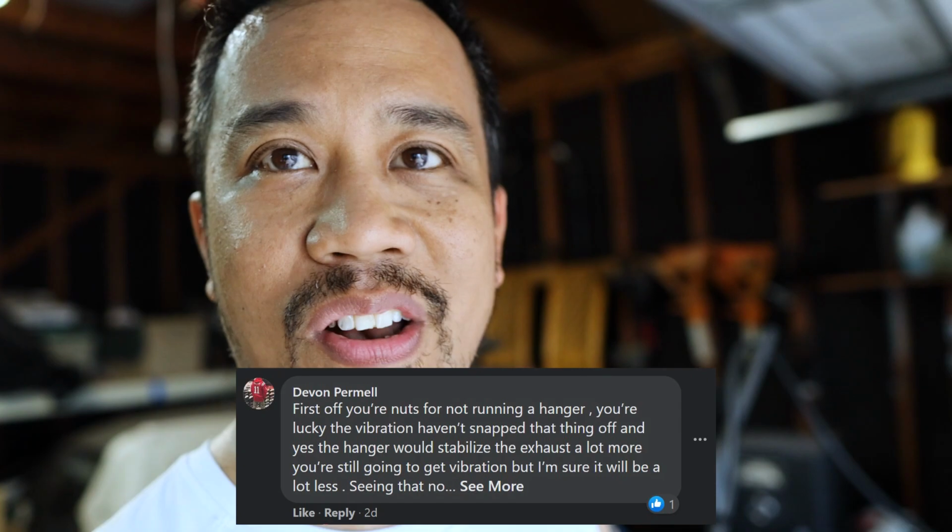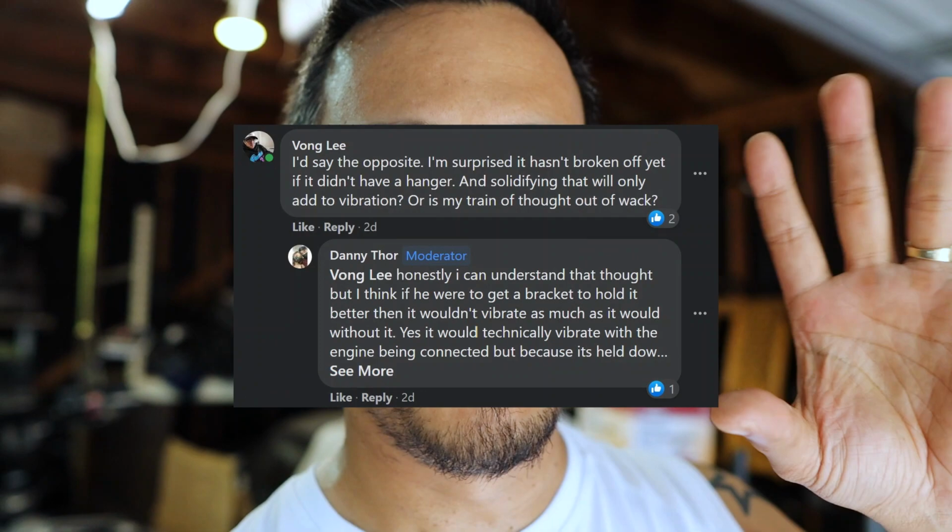So there's the hanger that we've been needing to put on for a long time, and I didn't really need to know it. Then I posted online to my subscribers saying that I think I figured it out, the vibration is because I don't have a hanger. Maybe I can post some clips down here of what they said. It was more or less, yeah, your exhaust should have cracked, or some other comment about it. My brother wants to start making exhausts, so a hanger is an integral part of making an exhaust now for a GY6 motor. So hopefully I'll gather some information out of this learning process. I also heard that running a lightened GY6 flywheel, which by the way I have and haven't installed yet, will also help reduce vibration and help with acceleration and top end by reducing spinning mass in your motor.